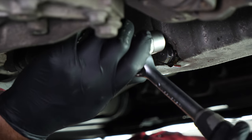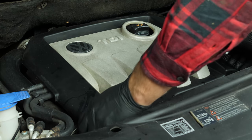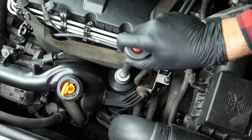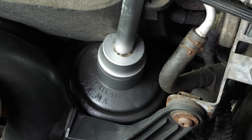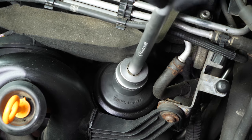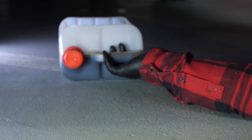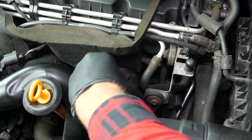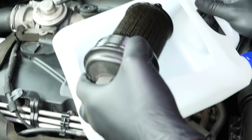When performing an oil change, it is necessary to replace the oil filter. To access the oil filter, you must first remove the engine cover. Using a socket wrench, a large extender and a 32mm socket, release the oil filter and turn it anti-clockwise until it starts to move freely. Finish unscrewing by hand. Place the oil collector, then leave the filter to drip for a few moments. Then put it in the collector, taking it out in such a way as to avoid spilling the oil.